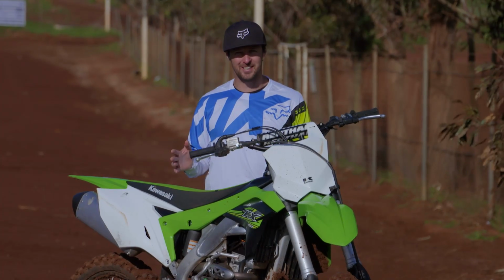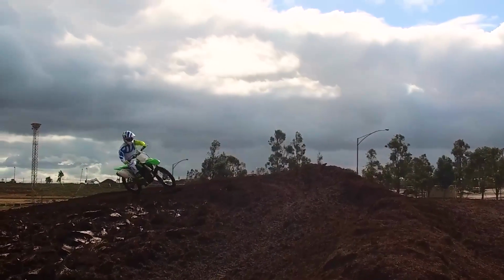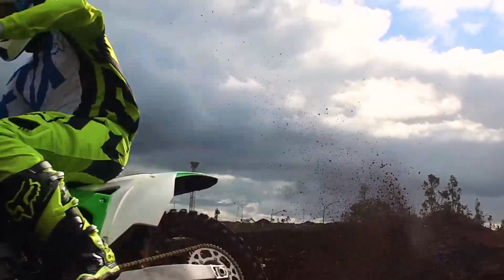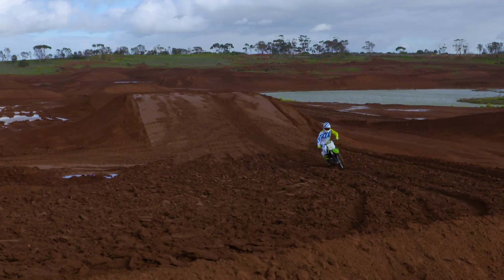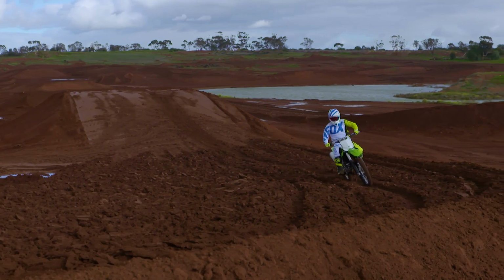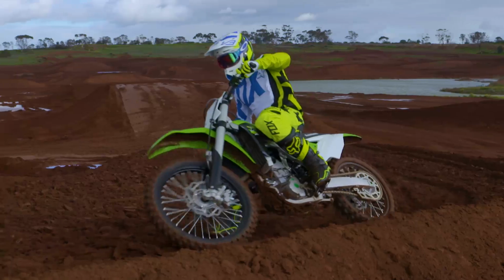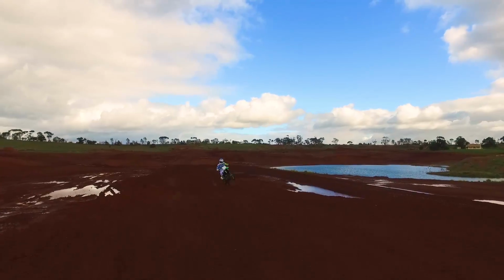Now for me personally, here's the big one, the chassis. This is so maneuverable, this bike, it is quite amazing, and it feels like you're riding this tiny little bike around that you can just throw all over the place, and yet it still handles very predictably going into corners. The Kawasaki just squatted very, very nicely going into corners. No random kicks to the rear end, but it still tracked really nicely out of the corners when you had those chattery bumps. So a very nicely balanced rear end, and of course, works very well with the forks.